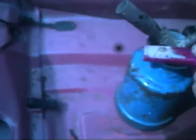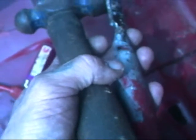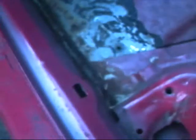There's two ways of getting this black soundproofing up. One is scraping it because it's quite brittle. Sometimes you put a blow lamp on it and do it with a scraper, but because it's brittle, most times hammer and chisel do the job. I'm glad to say on this occasion the hammer and chisel was the winner. Okay, so now the floor has been got ready to work on.